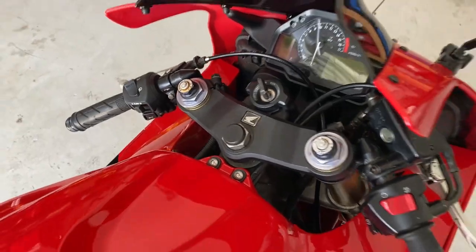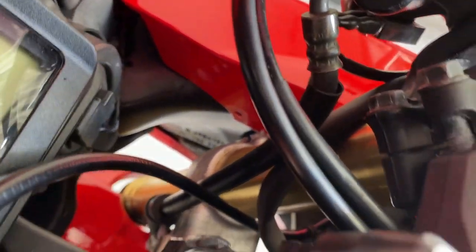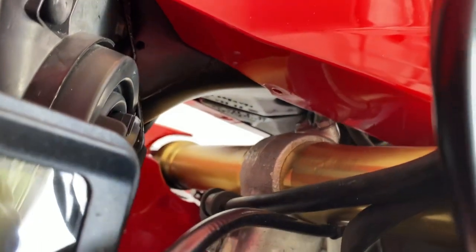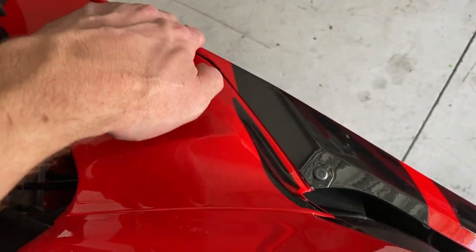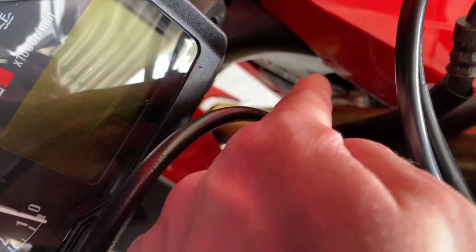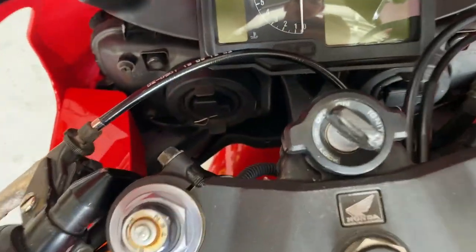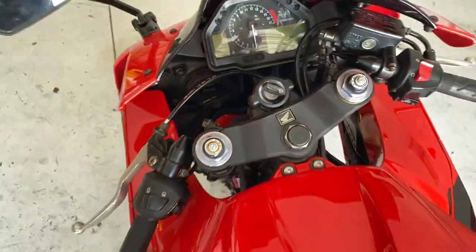I want to show that we are taking care of things and we'll get that swapped out. There are a couple other little plastic rivet holes that I don't have a fastener in. Something I noticed with this particular kit — for anyone looking at the NT fairing kit for this bike — you'll notice that it rubs ever so slightly in that area right there; you can see it's already starting to mar it up a little bit. That might just be some bad shimming on my part, but I haven't done any shimming on this side so everything pretty much fit together pretty well over here. You don't have rubbing on this side — it has clearance, so we're good there.